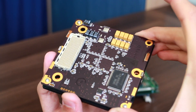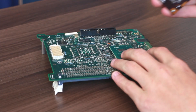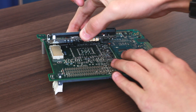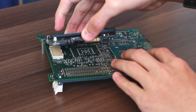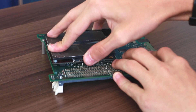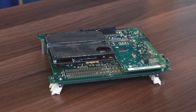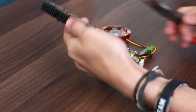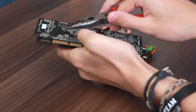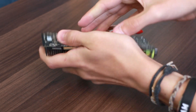It's just such a nice bit of kit. They are so, so hard to come by. The thing I had to worry about here was that because I didn't have a camera positioned to see where I was going, I had to hit this straight on. The G4 sockets are so, so delicate, and if you mess it up it's game over for both the motherboard and the CPU. Now that the CPU's installed, we can get to work on the graphics card. The first thing to do is to remove the existing heatsink — there are two little pins that you have to push through and then pull out of the heatsink.